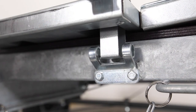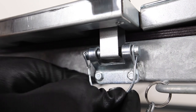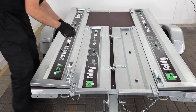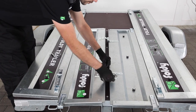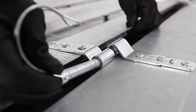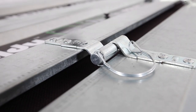To finalize their position align the hooks of the front and rear sidewalls with the hinges at the front of the trailer. Then insert the two safety bolts through the front hinges and fasten the safety clip to hold the front and rear sidewalls in place. With the remaining two safety bolts align the hinges of the bottom and top sidewalls and then insert them securing the safety clips. This will ensure the sidewalls remain flat and safely secured on the Foldy trailer's cargo deck when the trailer gets raised to the vertical position.